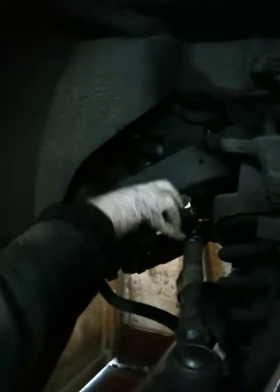And then all you do, because it's lined up, just tap the split pin in, nice and tight. I always tend to oversize the split pins because then they're not like a prick in a bucket. Right, then always use pliers and bend the split pin up. What LTI want you to do, and so does the carriage office, and pretty much so does everyone, including your mother. Right, I always bend both bits over.